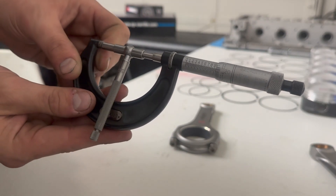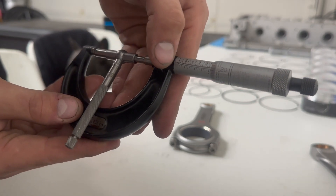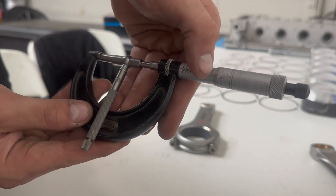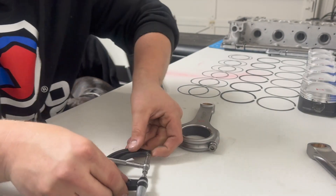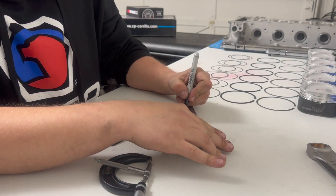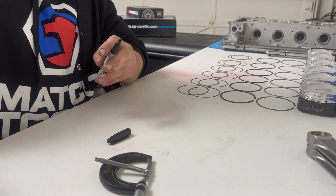The way this mic works: it's one-to-two inch, it's at nine — each one of those ticks is 25 thousandths. The number is 20, so it's two ticks: 25 plus 25 is 50, plus 20 is 70. So 1.970 for rod two, which is the same as the first one, which is ideal. I'm going to write 1.970 on that rod and do the third one.